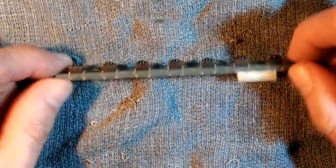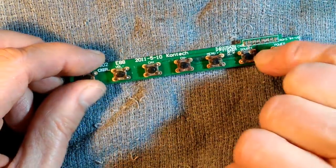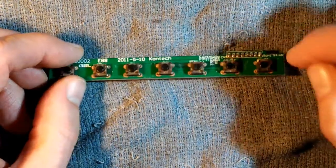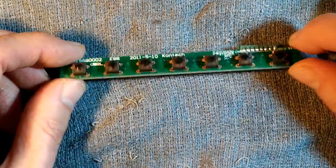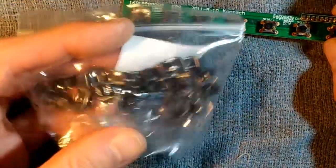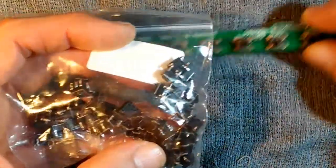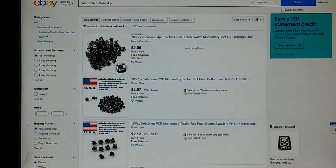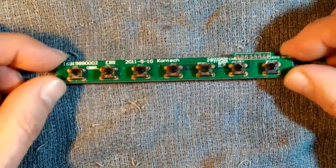The power button would tend to go first, then probably the channel button second, but you might only need to replace one. I'm going to replace a minimum of three. You can try to spray a little contact cleaner inside these buttons, but I've never had a lot of good luck trying to revive them with contact cleaner, so I'm just going to go ahead and replace them. You can acquire these buttons really cheap — I bought a whole bag full of them for like two or three dollars. These buttons literally cost pennies. So as long as you've gone through all the work of taking it apart, it's probably easier just to replace the buttons — that way you know they're fixed.